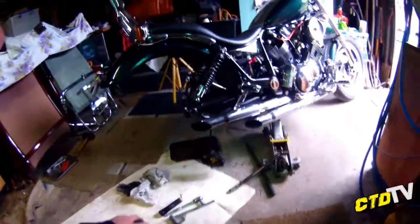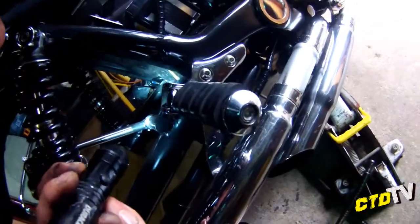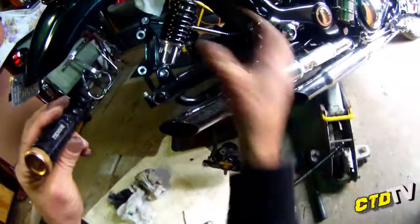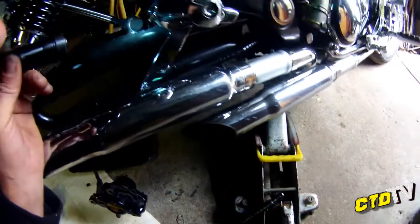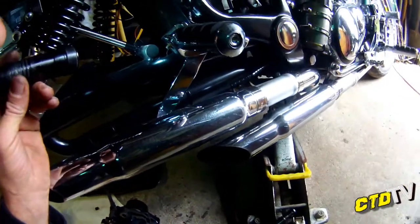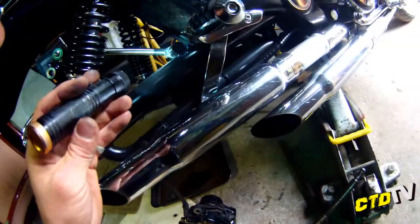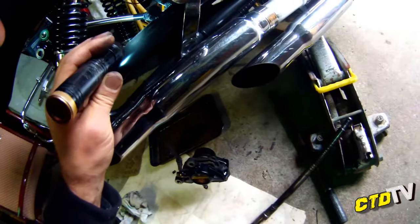While it's all off, up close and personal with this brake caliper steady arm. Now every brake caliper needs to have an extra arm or another point of contact to stop things from moving when you brake. You don't want your caliper to spin around with the disc. Now, I haven't had this officially engineer certificated, but this arm itself, I had a guy I knew at the time, working as an engineer out of his house. Yes, so that is a stainless steel arm with pivot arms and little grub screws in the pivot arms to lock on or not. But you want it to freely move around relatively.